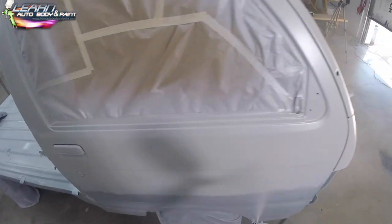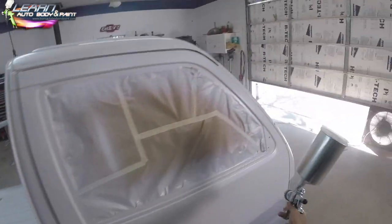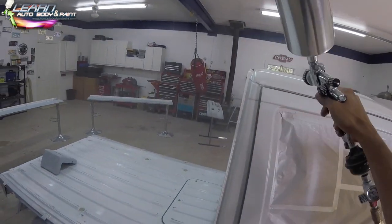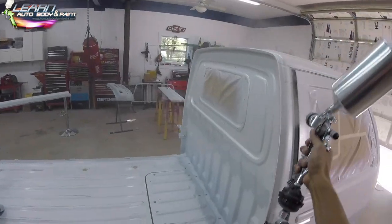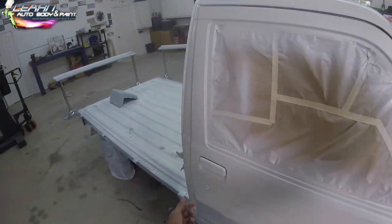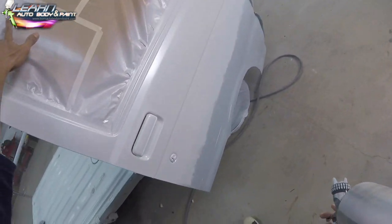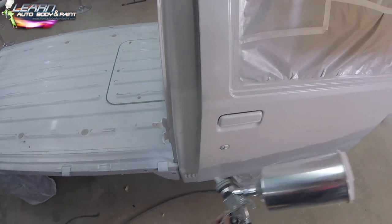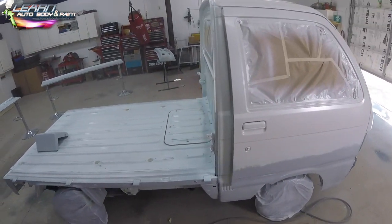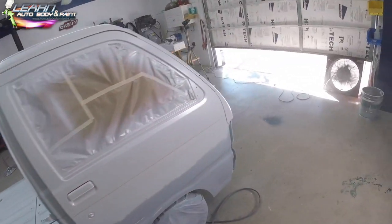This is our second pearl coat on the outside using the DBC 500 clear base coat with X Finishes Moon Dust Pearl in it. After this we're going to be masking it off. We're going to spray silver quickly on the bottom because this is a tritone paint job. We're only doing about the top one-third of the door — the middle part is going to be teal and the bottom is going to be silver — so you'll see me dust some silver base around the bottom.